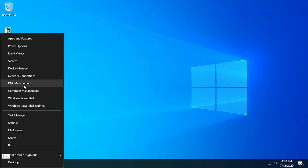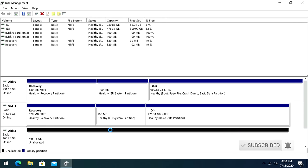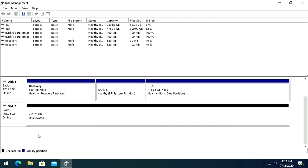To prepare it — mind you, if this is a new drive you don't have to worry about this. I'm doing this to make it easy for people that might have already had a drive they used and want to convert it into a C drive. I'll click on Disk Management again, right-click on WD Demo Install, click Delete Volume, and confirm. Now if this was a brand new drive you might have to right-click under the disk and initialize it, but I don't have to because I've already used it before. Now it is a 100% clear partition.